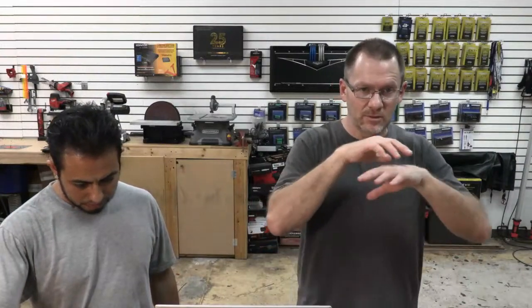If you have an existing radio that has line level output, so you're feeding this DSP amplifier a full range signal, there is no roll off, there is no de-equalization being done. Like you have an Amp Pro or a Zen feeding in, and it's all set and ready to go. Well, then there's no extra tuning you need to do to go to the BT24, because you have a flat signal coming into the amplifier, you've EQ'd it to the car, now you're going to go to your Bluetooth dongle.